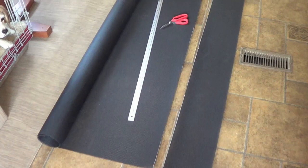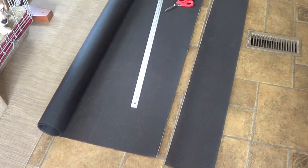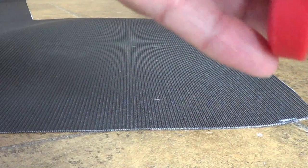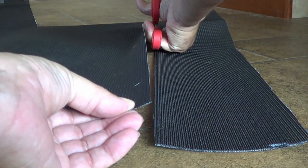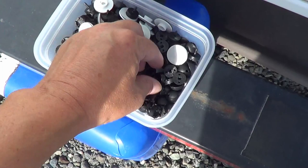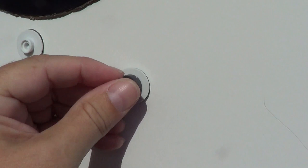Shaved off eight inches — it came as an 86-inch roll. I guess they come in seven by six foot rolls, maybe a few extra inches. Now I just have to do my other cut and get it down to 45 by 78. This stuff cuts really easy — all you really have to do is kind of direct the scissors into the cut and it just zings along. Got her cut out. Now I'm just going to go along and put in these little pegs, snap them on to all the studs there, and I'll be able to start hanging the material.